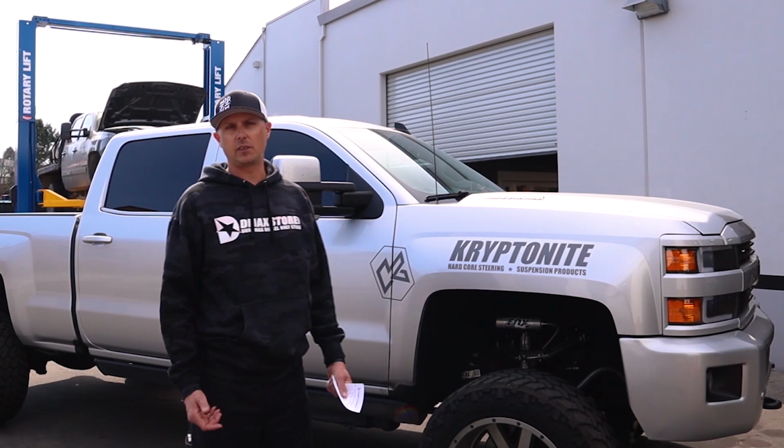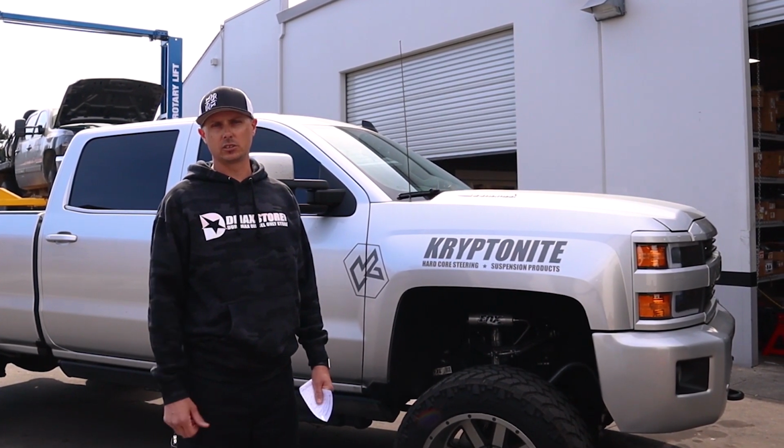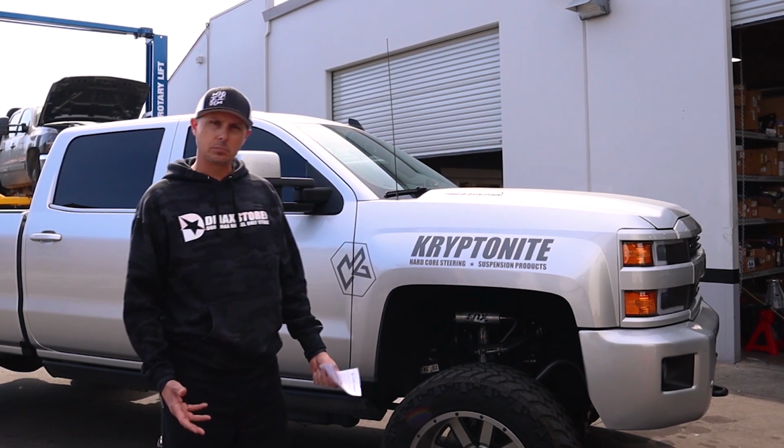The LB7 is a very important one. We really want to do a lift pump on every LB7 because of the way that those injectors fail, and we found the lift pumps, especially AirDog, help with that system. So that's why we like to put these guys on.